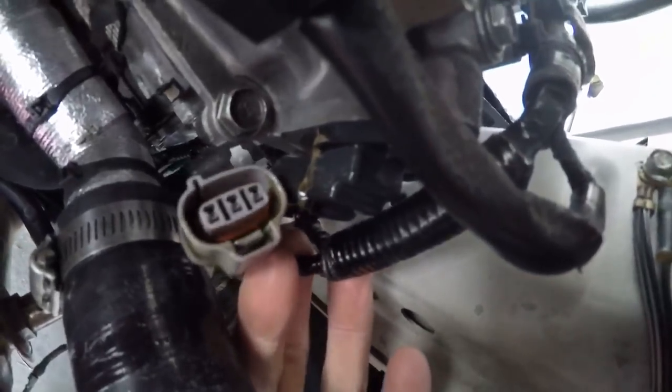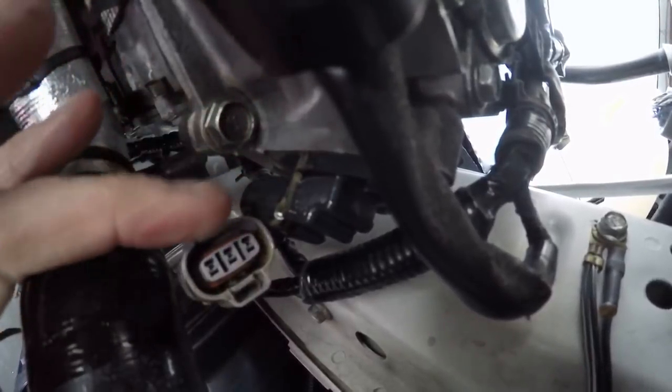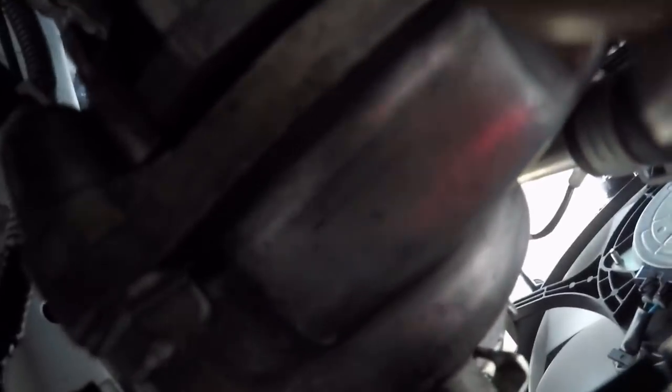You can see in that connector itself there's a lot of oil, but I do think it's coming from the seal and getting in here a little bit. It doesn't get past the orange seal in there. I don't think it's coming out of the switch itself at all — I think it is coming out of whatever seal is between there and the block. If I can push this camera right up in the right spot — right where my finger is is the crack where I think the oil is coming right out.